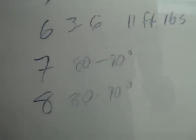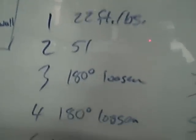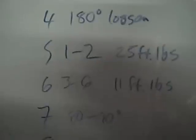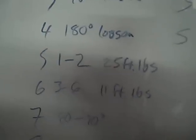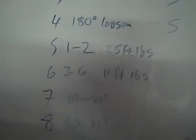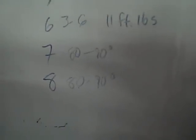So the inside ones will actually be a little bit tighter than the outside ones, and that's how you do Subaru. Let me back off — or I'll just go down through it again: 22 foot pounds, 51, 180 loosening, another 180 loosening. Numbers 1 and 2, which are the middle ones, you tighten to 25 foot pounds. All the rest on the outside — you'll find a lot of them are painted orange — will be 11 foot pounds, then 90 degrees, and then another 90 degrees.